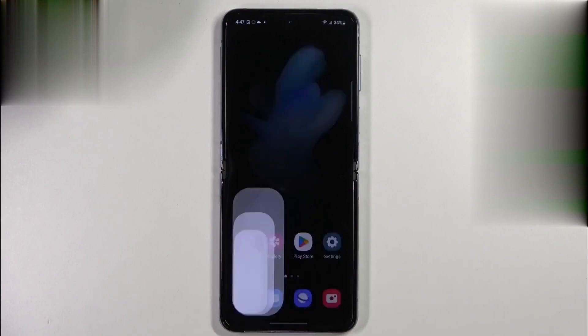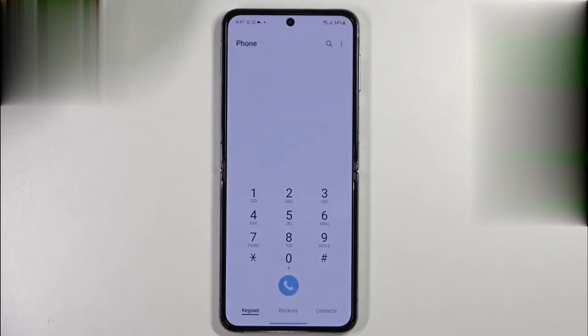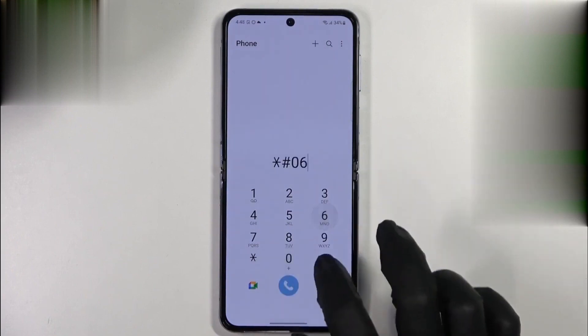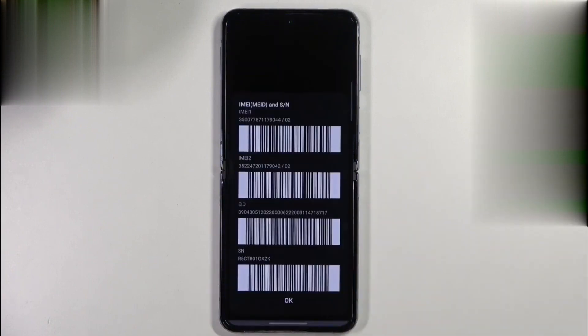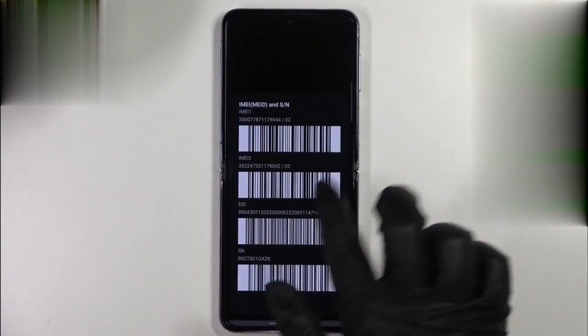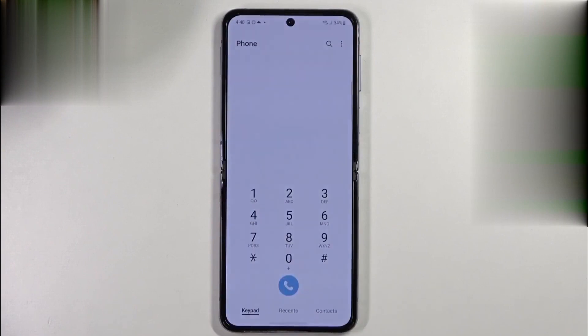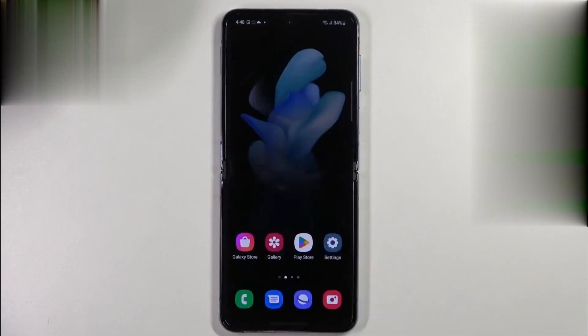To start, we're going to get the phone's IMEI number — that's a unique number for every phone. Simply dial *#06# and your 15-digit IMEI number will appear on the screen of your phone. This number is very important; it represents the ID of your phone. Keep it somewhere close because we're going to use it in a few seconds to unlock the phone.